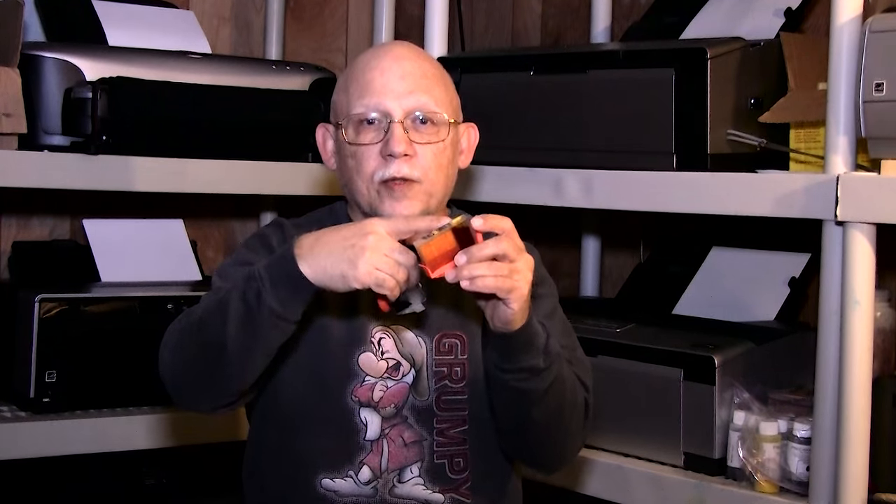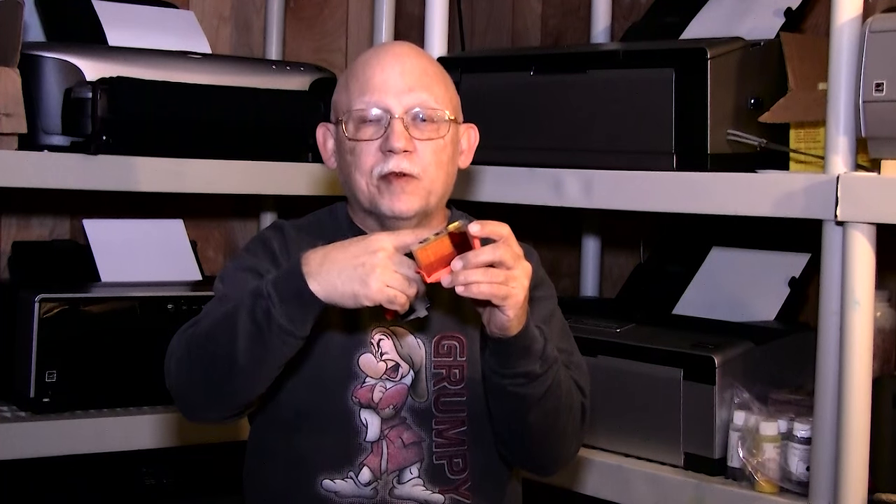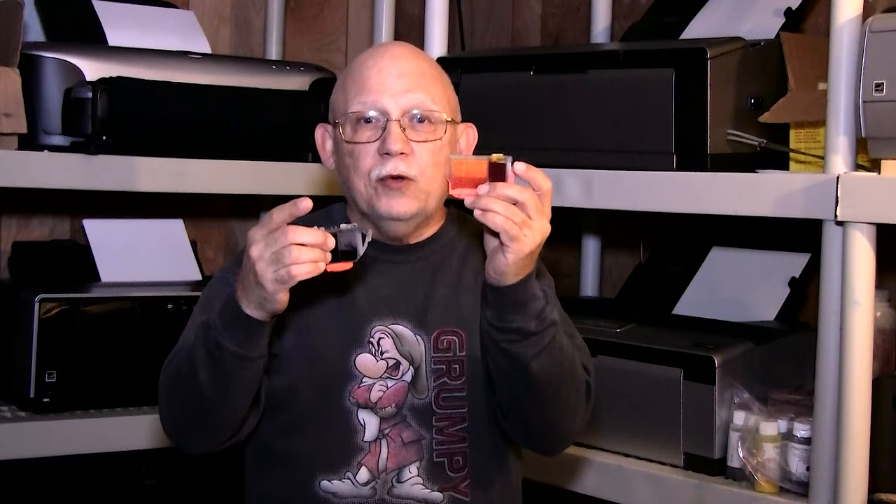Basically you have to modify the carts to allow you to insert a plug where the ball used to be — the factory refill ball. I show you that method in an earlier video; it's quite simple. Once you have that modification performed, all you have to do is reset the cart and add ink when it hits low.